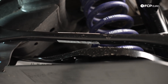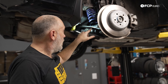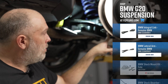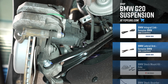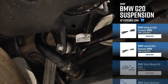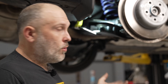This is where the G2X generation starts to get interesting — there's a lot of consolidation of individual parts. Control arms become asymmetric instead of symmetrical. You have your toe link and your camber link; the camber link is also the spring seat, and these are the same part numbers left and right. The trailing link in the forward location is the same part number left and right. The upper forward wishbone going to the forward portion of the subframe is also the same part number. The only part number that's different is the upper middle control arm which has a curvature in it. So basically four to five control arms are the same left to right in the rear, which makes ordering very simple.